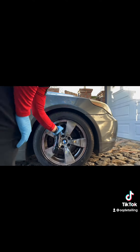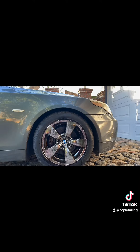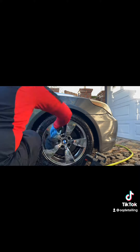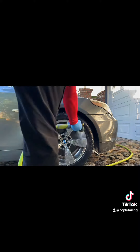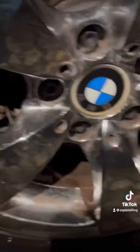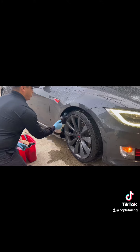Now back to the wheels — I did use an iron remover twice. I also used a high alkaline cleaner at full strength and an acidic cleaner, but it did very little. Theoretically speaking, you could use a very heavy duty acid cleaner, but you could run into the situation where it might stain the rim and it could possibly look uglier. So it's a situation you've got to mitigate by talking with the client, explaining the situation, and either getting the okay to use it or just letting them know that it's permanent.